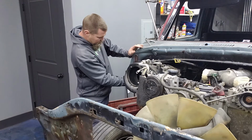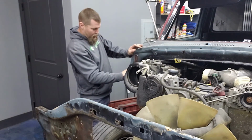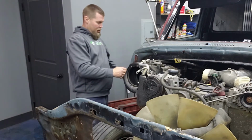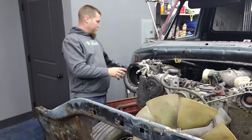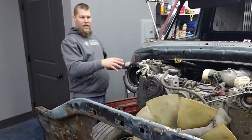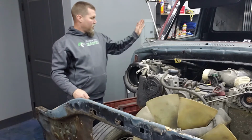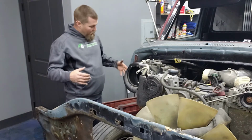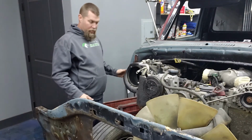I've tried to shoot a little penetrating oil into the backside. I'm going to see if I can just get this one bolt loose. See if I can kind of roll this bracket up just a little bit. I think it'll help it fit a little bit tighter here. Now kind of beat the door out some and beat the fender out some, and I drove the cowl panel in just a little bit. I got the door readjusted. So hopefully moving everything a little bit, I can stick this thing up here and it'll fit pretty good.